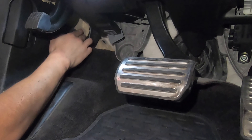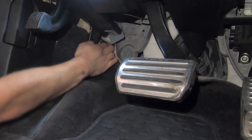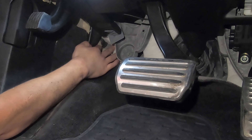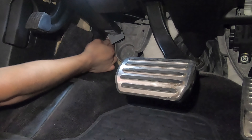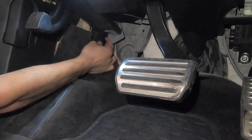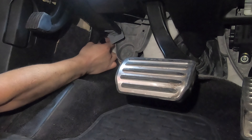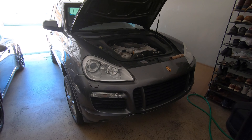The final drain we need to modify is the front sunroof drain on the left-hand side of the vehicle. Go to the left-hand side footwell — it's located in the corner, very similar to the other side. Just move the insulation around and you can find it. Pull it out, take care of it, and put it back in just like you did on the other side. Now we've taken care of both front sunroof drain ports so they won't get clogged in the future.